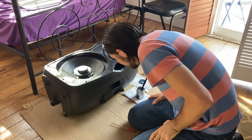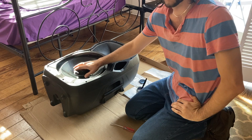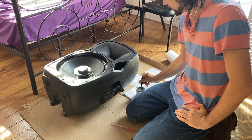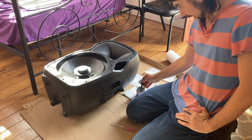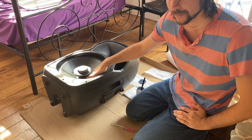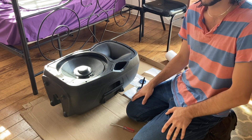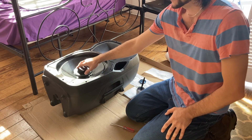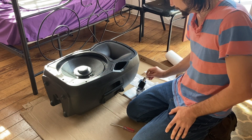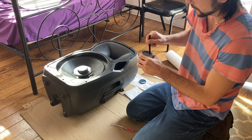Now here I have my woofer cone. For mine I don't have the little bubble in the middle — this is a light-up device which lights up the cone — so I'm going to be careful to avoid that. At the bottom there's usually a little bubble; here I have a little foam pad that's separating the inside of the cone from the center of the light device. Just be careful not to get too much of the Varathane dripping into that foam piece.